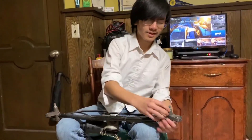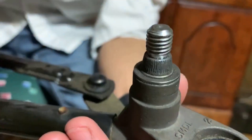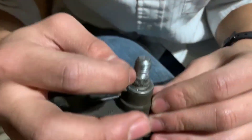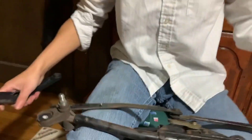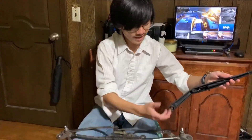So with that out of the way, let's explain why we're fixing the car. Our old transmission linkage — this right here, not to be confused with the transmission gearbox — was broken. The reason was because these studs, called knurled studs, are supposed to connect with the wiper arm at this ridged point right here. What happened was during the winter, we tried to turn the windshield wipers when they were frozen. When frozen, they won't turn, but the motor still tries its best.